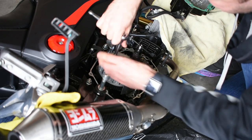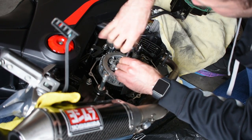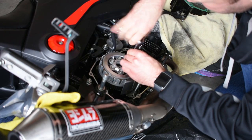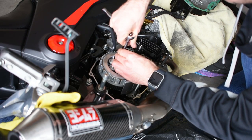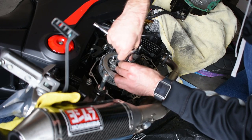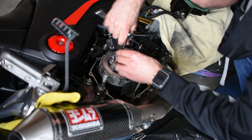It's time to tighten down the bolts on the 60% stiffer springs and lift plate once and for all. Just like before, use a quarter-inch socket wrench with your hand choked all the way up to reduce leverage and increase feel of resistance. Go in a circle or triangular pattern tightening all the bolts — don't get greedy. Just one to two turns each bolt, keeping it level and not letting it bank to one side. As it gets close to seating, reduce to one half turn each. When you feel a sudden increase in resistance on the bolt, you're seated — give it a one-eighth turn more to cinch it down, and they're good. Congratulations, it's easy from here. This is another good time for a break — pat yourself on the back. You're done with the hard part and you've earned it.